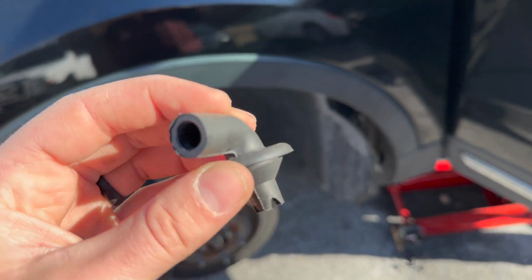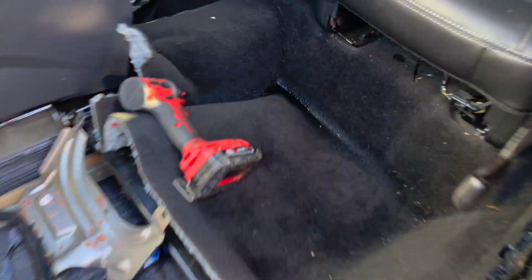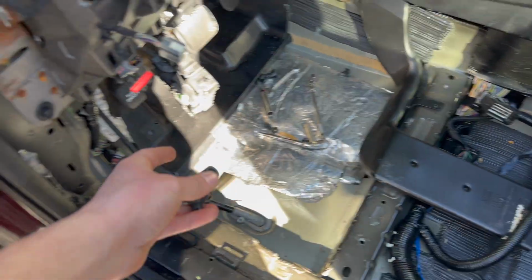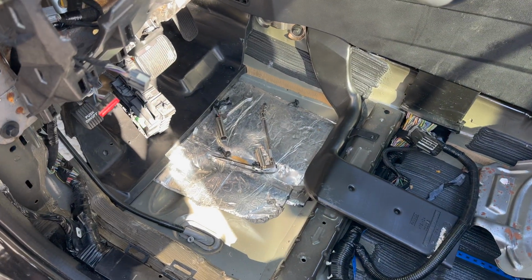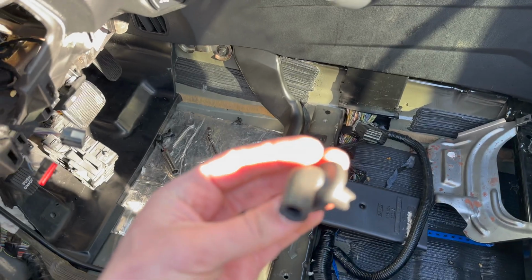This is the reason why the car would have water inside, and we literally filled up the whole car with water. It was because the hose, the drain right here, this one, would be literally loose, would just drain the water straight into the car, and little by little the car filled up with water in about a week. So that was not fun at all to find this.